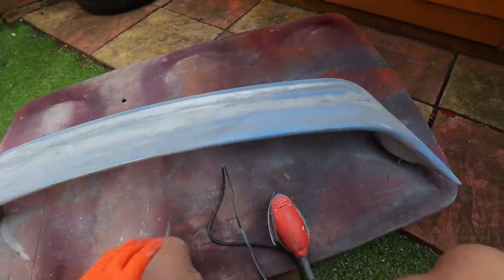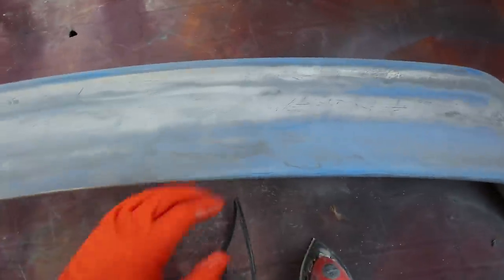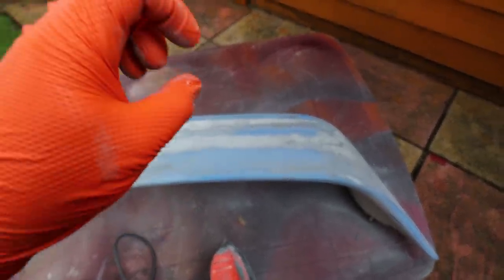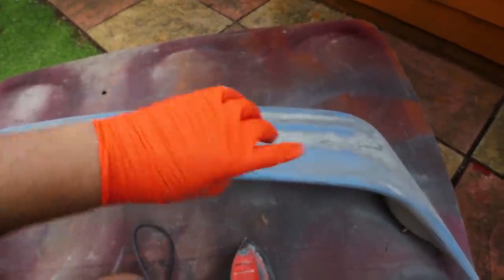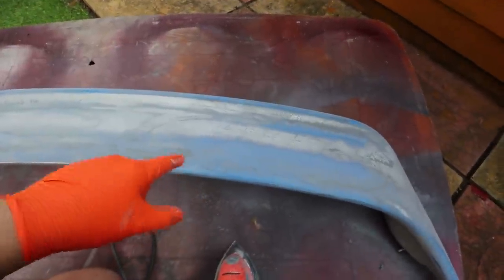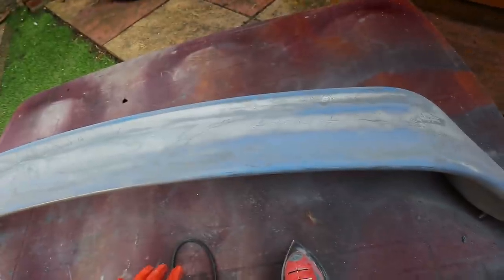About 20 minutes of sanding later, this is what we are down to. I've completely forgotten that this spoiler was off an Arden Blue GSI — I bought it off eBay in blue — and that blue has started to reveal itself now as I've sanded down. What seems to have happened — and this is my unprofessional opinion — is the primer seems to have reacted with whatever was on the blue paint. I can't remember if I sanded off the lacquer properly, but the cracks and scratches actually went down to the blue paint, so I don't think it was the silver base coat's fault. I think it was the primer that reacted with what it was painted onto originally.